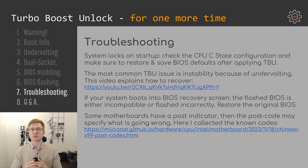Another very common issue is related to undervolting. If the CPU voltage is reduced too much the system won't be stable — sometimes so unstable that it is dangerous to flash another BIOS, as the system may lock up right after boot or after a few seconds or minutes. For this situation I made a detailed video, but in short you need to go into the BIOS, disable Turbo Boost, force the CPU to operate at the base clock frequency, boot into the system, and then flash a BIOS with a better-suited voltage for your CPU.